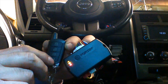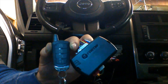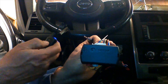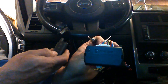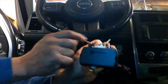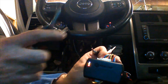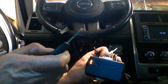We can shut the vehicle down by pressing the bottom button and the second button up, or the power icon. We want to make sure when we're doing our testing that our kill switch is not on. If the kill switch is on, and you're using an RF antenna kit, the convenience features — locking, unlocking, and releasing the hatch — will still work, but the engine will not start by remote. If you attempt to start it, you will get the five-flash error. Turn the kill switch off and retest. No matter what RF antenna kit you choose, the OEM remote will still retain the ability to start the vehicle or turn it off.